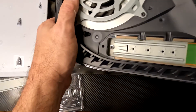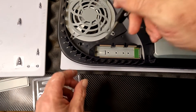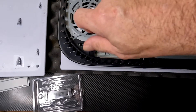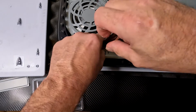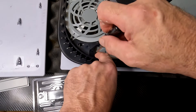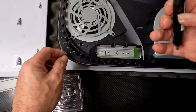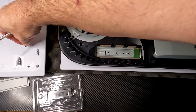Down in here you'll see a micro Phillips screw — it's kind of hard to see with the shadow but it's right there. We're going to take that out also. You'll need a micro screwdriver or like a glasses screwdriver. It's a very small screw — do not drop this down in your PlayStation anywhere, especially in a fan or a motor. Set that somewhere you won't lose it.